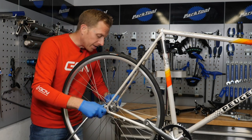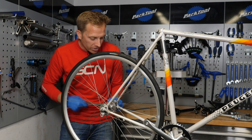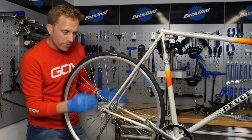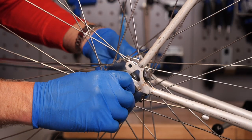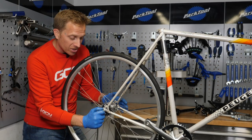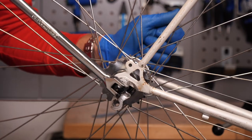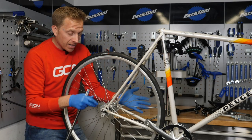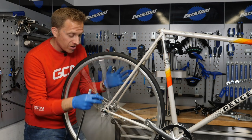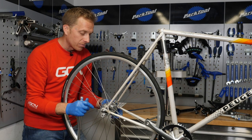We're just going to loosely tighten up this wheel into place so we can start making the bike look more and more like a bike. The reason I say about playing around with the chain line is you want it to be almost as straight as possible — the chain itself should not be running at any unusual angles. But believe it or not, I've seen riders in the Olympics, World Championships and all sorts using terrible chain lines and they've never had a chain dislodge. The way we used to set it up on track bikes years ago was pick the bike up and shake it around a lot and see if the chain fell off.